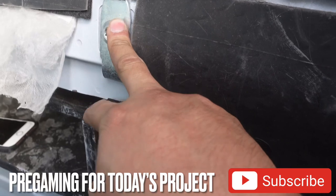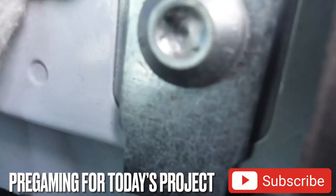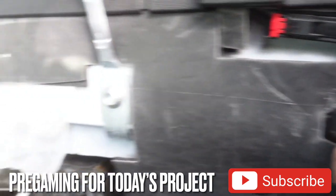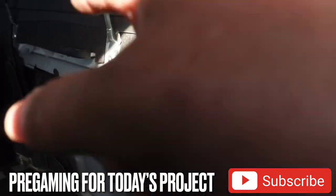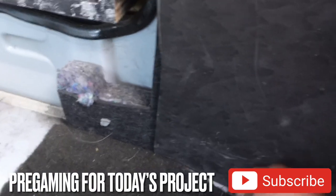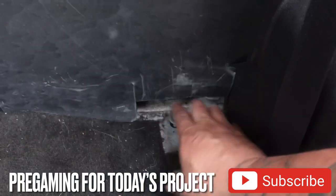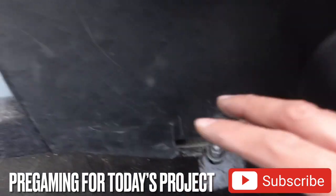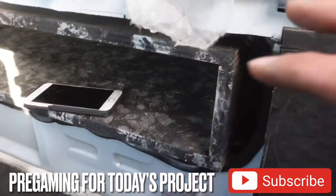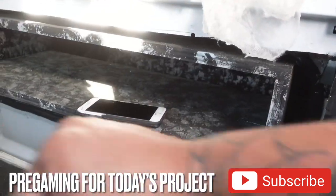In order for my panel to actually sit flat, I have to cut these things off — I'm probably going to have to take them off completely. There's three of them. I have to look for a T47 or a T50, something like that, cut these off with the air saw. Then we can put our piece going from side to side, trim it so it drops down pretty good back here. We're also going to have to notch it out just so the seat bracket can go back in and we can put the bolt down. After that we can do our lip, put our piece in, rough draft cut it, then run the router.